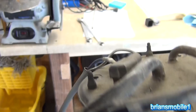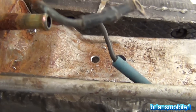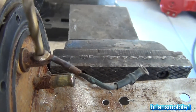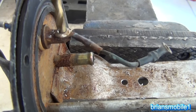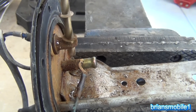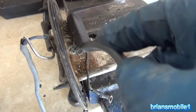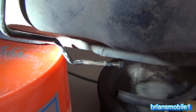Upon looking at the derelict connections for this thing and how rusty they are, I think it might be in our best interest to make some new connections. Just have to remember that power comes from this one and ground comes from that one - just imagine the ground is lower. The little posts are marked and the little post is the power one. Look how corroded and rusted and gross that is - it needs to be wire brushed badly. It's getting better. I've got the little vent line or return line capped off.